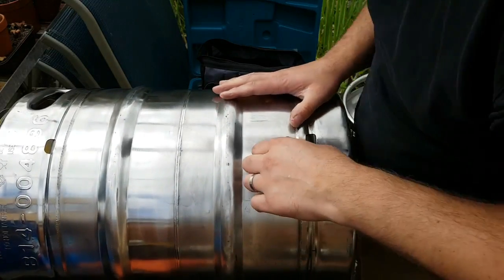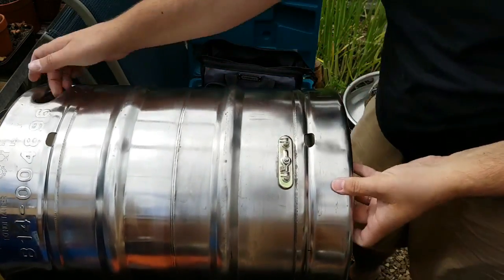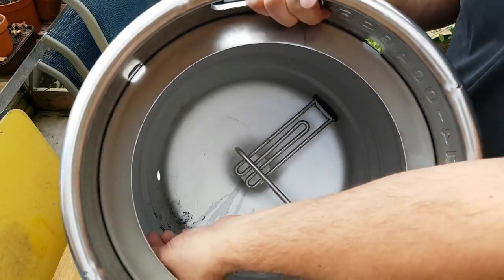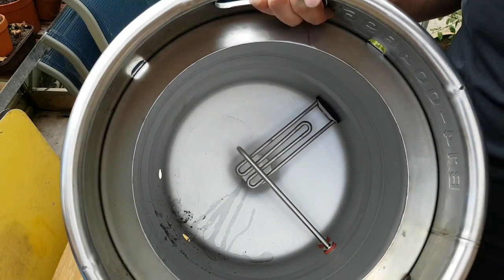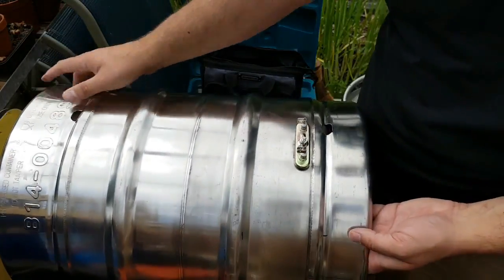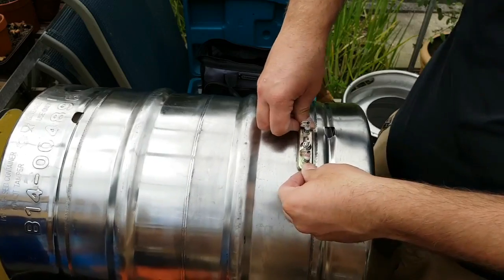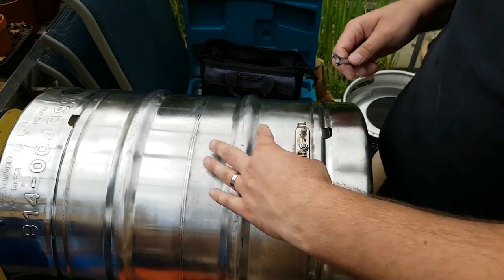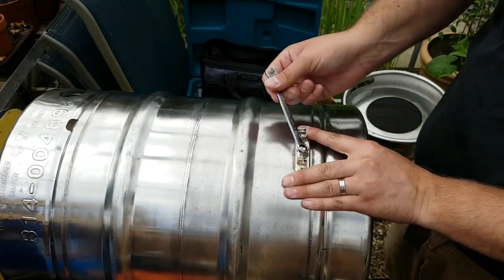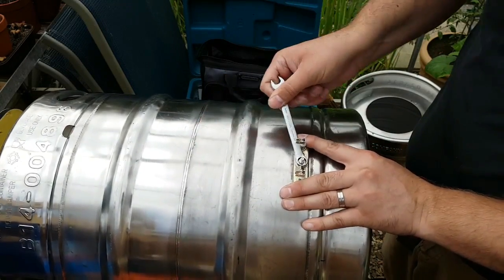Both sides are in. It's down as far as I can get it, so it's sitting below the element that's already in there. You can see there's all the swarf and the cutting in here as well, which we're going to get out in a minute. All there is to do is just tighten up this 10mm nut on here - ensure it down at the same time. Don't have to put too much pressure on it.